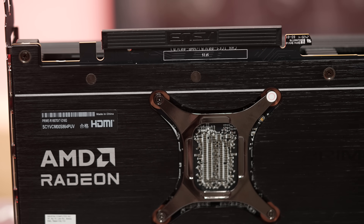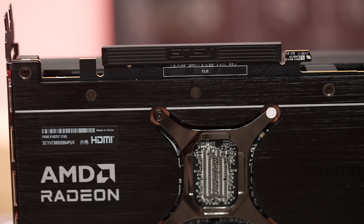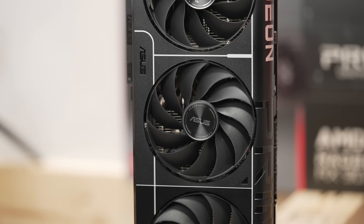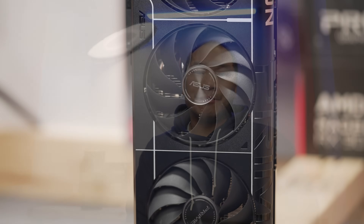Unfortunately the GPU market is kind of wild right now, so it is what it is. The main focus here: I want to show you how the XT undervolts and how you can tune it a little bit, given the high board power spec. I would anticipate that a lot of SFF enthusiasts are looking to drop power a little bit — just reduce the impact on the system.